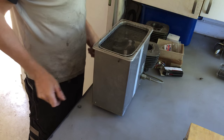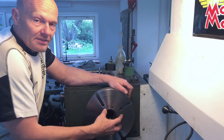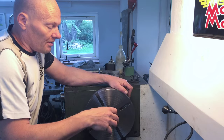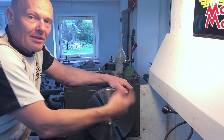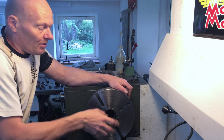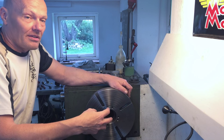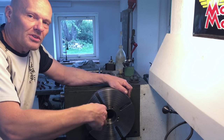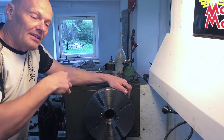When it's done, I put the crankshaft into the ultrasonic cleaner. I cover the ultrasonic cleaner with a couple of blankets because it makes a terrible noise, and also because the solution is heated, so the blankets provide insulation. The cylinders are mounted to my face plate, which I modified with drilled and tapped holes. This gives several advantages: it's very easy to set the cylinder up, you get rid of clamping equipment that may get in the way, and it's mounted the same way as in the engine — so any out-of-roundness when the bolts are tightened will also be present here, giving a fairly round result when finally mounted.